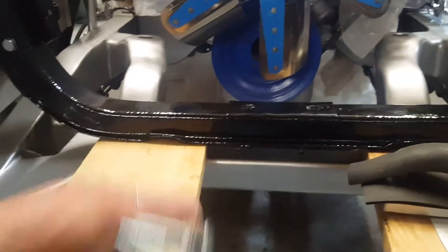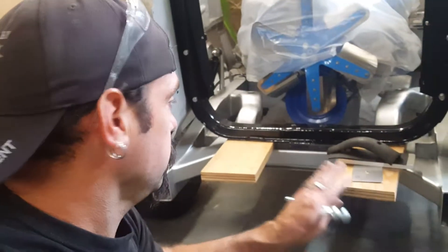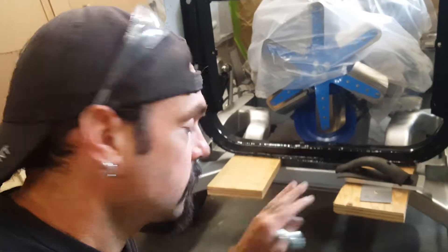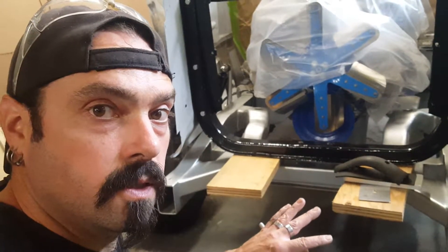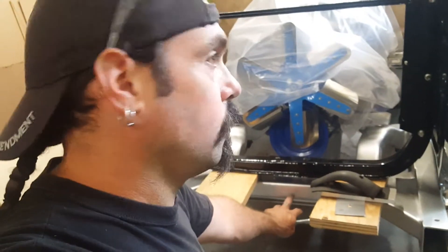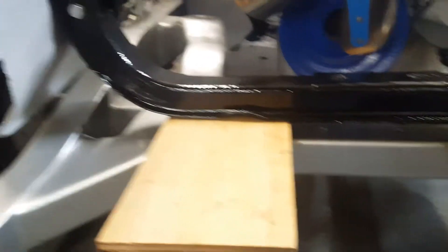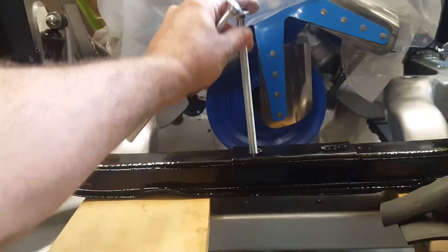In all the videos that I did going back for a long time, you'll notice that this has all been tubular boxed — this chassis. So four or five things that I didn't do yet: one is drill all the body mounts. The original ones were here but it was a piece of sheet metal. As you can see my holes in here, I got it centered and basically drilled for my new carriage bolts.